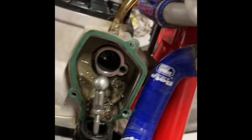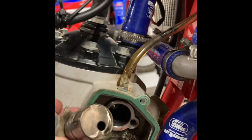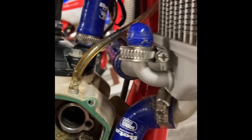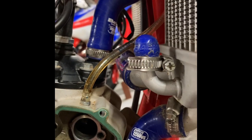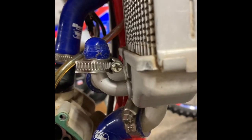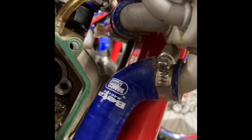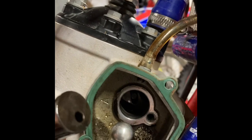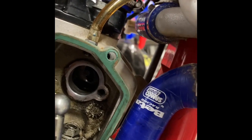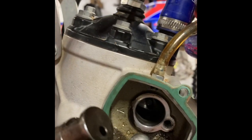Okay, next I'm coming over to the right side of the engine, and I'm going to install the right power valve. Notice that it has a hole in it. That is going to mate up with the end of the dowel rod that you can see when you look down into the hole. A little bit hard to see with it being dark like this. You're going to need to locate that dowel rod by rotating this until they engage.